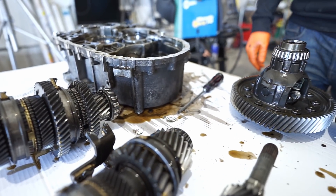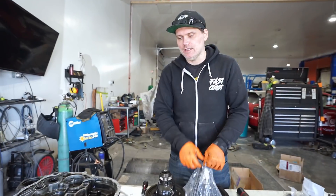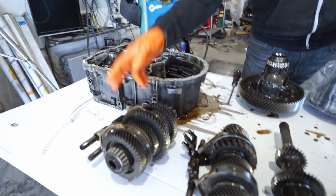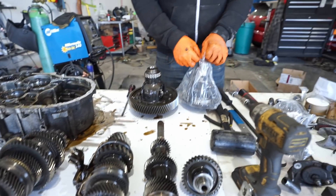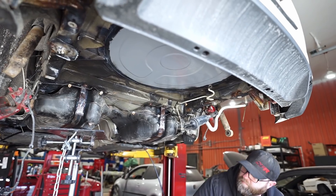Day two. How's it going? What's the progress level? Well, we got the transmission out and I got the transmission apart. We're going to put the all-wheel drive diff in and put it back together. I might upgrade the shifter forks at the same time. And Robbie's working on the pan - we got the pan in and the gas tank's in now. Just got it in. So the rear end is going to be in and done very shortly. Then we got to work on getting the transmission back in and doing the things in the tunnel.